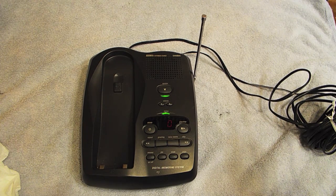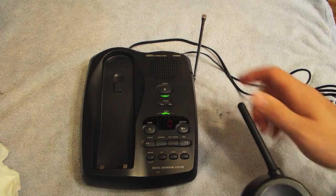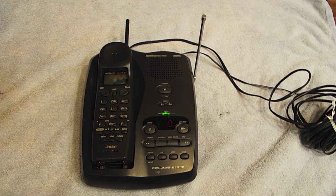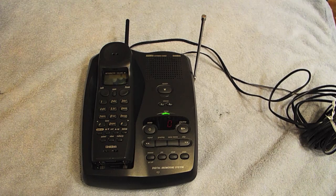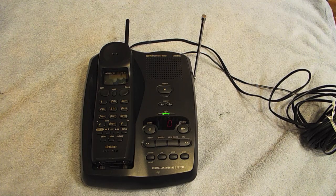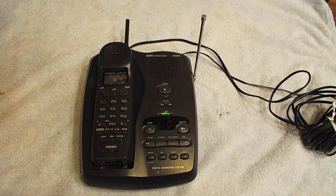Message canceled. Goodbye. Okay, so that appears to be working properly. The other test I do on these telephones is I turn it on, unplug the phone line, and let it run in talk mode for several hours just to make sure it won't have any glitches or anything. I've already done that on this telephone and it has passed that test. So this telephone is now ready to be put in service — the buttons are clean, everything is working correctly, and all the functions are good. Thank you for watching, I hope you enjoyed the video. Comment, subscribe, and out.